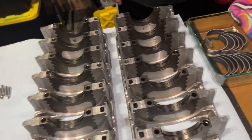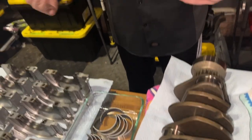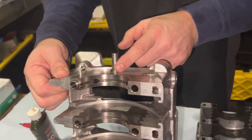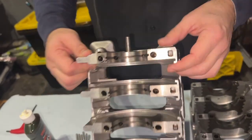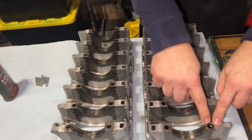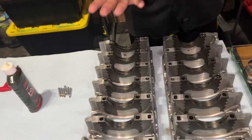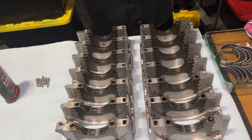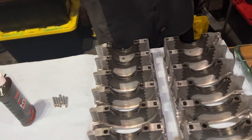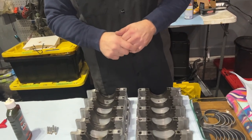So the direction. Here is the crankshaft. Here is where the crankshaft pulley goes. I'm using all of that towards me, which means that on this crankcase half, this little pin, which really doesn't need to be removed for any reason, will be pointing towards you. This half has dowels that match to these dowels. So when you put this over like that, you have to have them match. They're machined when they're matched. So if something happens to one of the halves, you've got to get the whole thing.